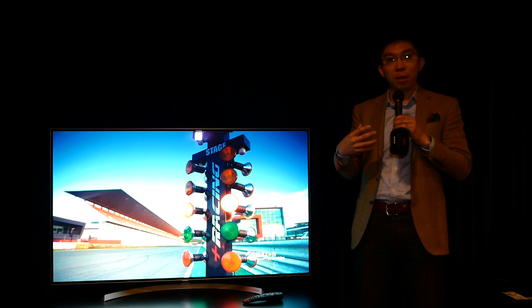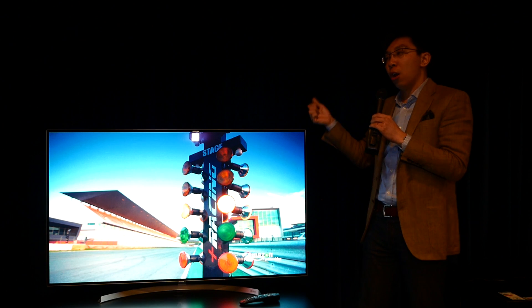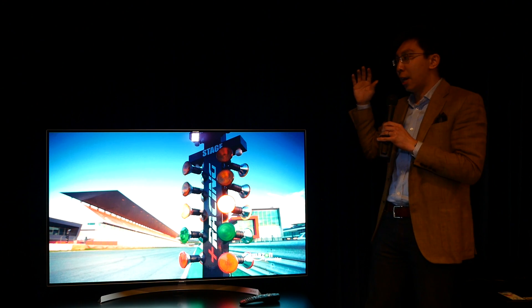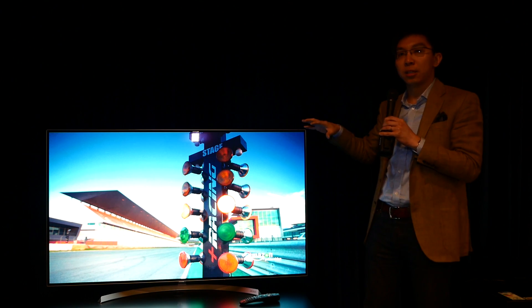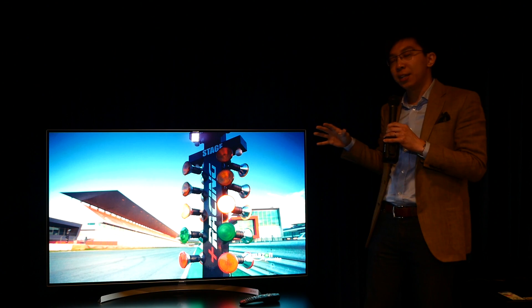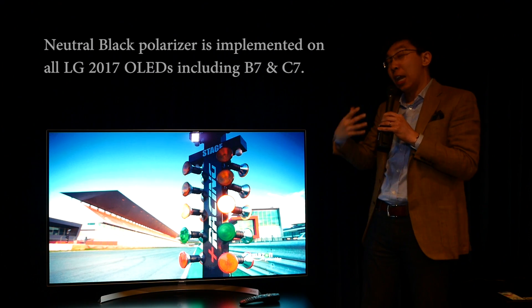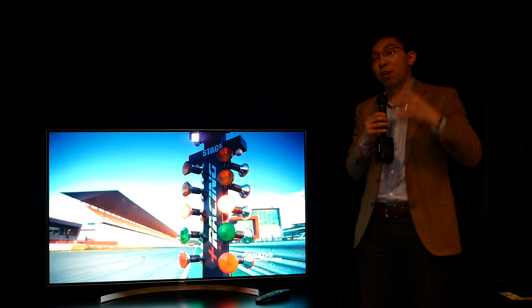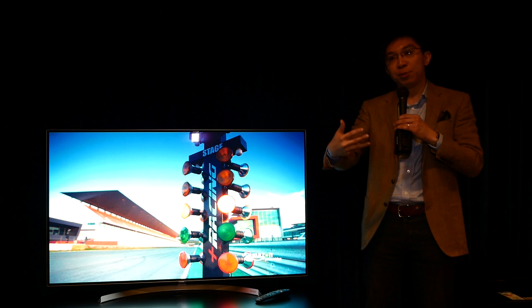One thing I forgot to mention in previous videos regarding LG OLED is the presence of a neutral black polarizer that absorbs reflections from the screen. On last year's model, some rival manufacturers also pointed out that when light hits the LG OLED screen, there's a slight magenta-purplish tint to it. LG has taken this feedback on board and applied NBO — neutral black OLED — a polarizer used not for 3D but to reject ambient light very effectively, creating truly inky blacks even in the presence of ambient light, which is especially obvious here with spotlights shining on the television.